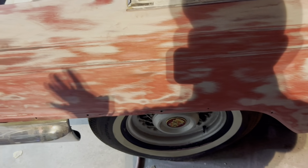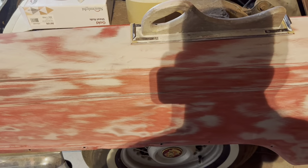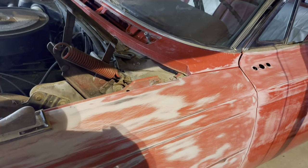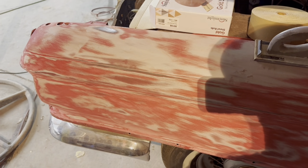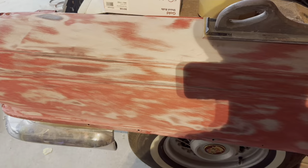And all we're gonna do is take care of blocking off the excess paint. The quarter panels, I mean, are horrendous, so they're gonna take a little bit of filler. But up here, no, it's not that bad. Doors maybe a little bit too. You'll see when we get to them, okay? Anyway, so this is the car, and this is what you can do if you have paint that feathers. If it's not feather edging, then no, you're out of luck, sorry.